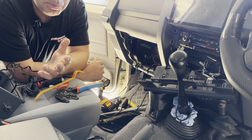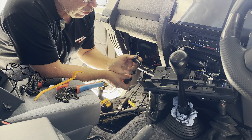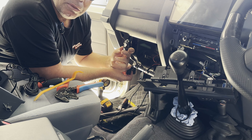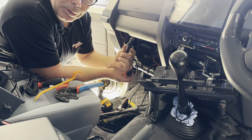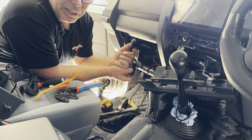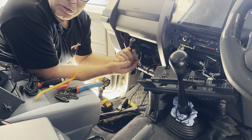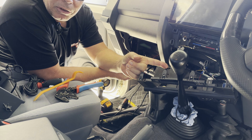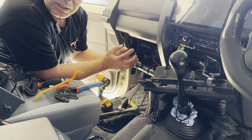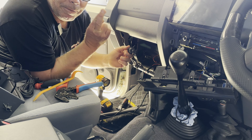It's a new day because it never goes as easy as we planned, but I have worked it out. I ended up putting the cigarette adapter back on — you can buy a hard wiring kit, as I found out. What I didn't realise is the monitor basically needs 5 volts, not 12. This adapter steps it down from 12 volts to 5, so you actually need it. A hard wiring kit is about 60 bucks, or you can go to Jaycar and get an even cheaper one for about 22. I'm going to tap in from the existing cigarette plug in the dash that I've turned into USB, connect this up, insulate it, pop it up in there, and we should be right to go.